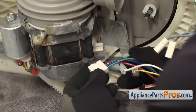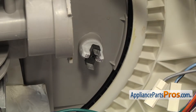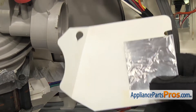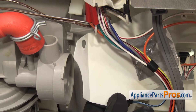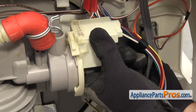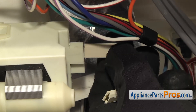Now that we have the retaining clips in, we can reattach the wiring harness to the motor. All you have to do is line it up and snap it on. Once you have it on, we can attach the wires to the temperature sensor. All you have to do is plug the wires back onto the sensor. Remember the yellow one was on the bottom and the white one was on the top. Before we put the drain pump on, we have to put the shield on. You want to make sure that the hole on the shield goes right on the pin here on the side of the sump. All you have to do is get the shield behind the wires and hold it in place. We can grab the drain pump and push it into the sump. Swing it over so it locks in place. Once you have the drain pump locked into place, we can reconnect the wires — remember the blue wire was on top and the gray wire was on the bottom.